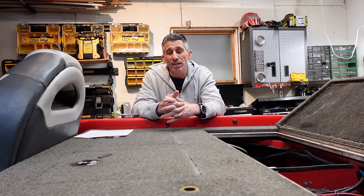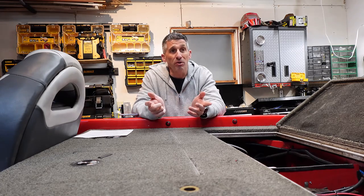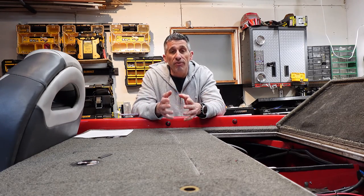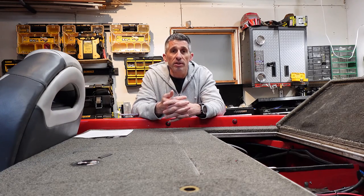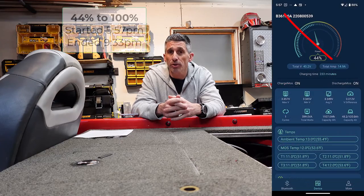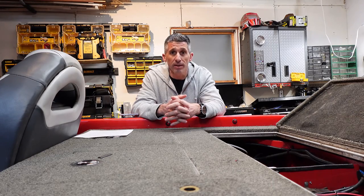The method of thinking that changed for me is: with the Bluetooth app and the external meter I can actually look at my battery and figure out how much is left for the next tournament. If I'm coming back with 60% or 70% I don't really need to charge it — I can shut it down, leave it in place, and it's ready to go the next day. If I do need to charge, lithium iron phosphate charges so much faster than AGM and lead. I plugged in the 15 amp charger that came with the Epoch 36 volt and went from about 30% to 100% in just under four and a half hours. Previously with lead or AGM it's on all night and then float charging the next day. So if I needed quick juice I could plug in for two or three hours and probably have enough to run a standard tournament.